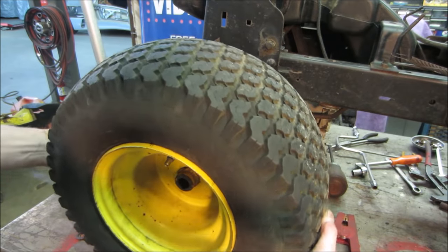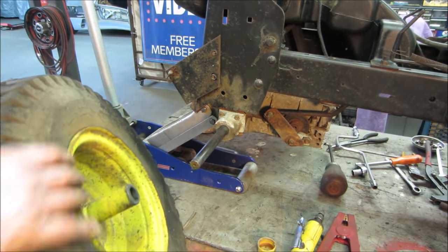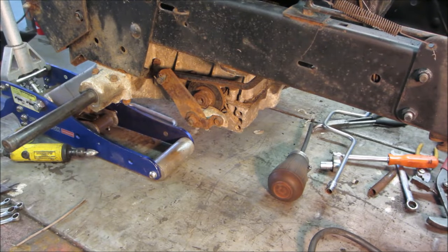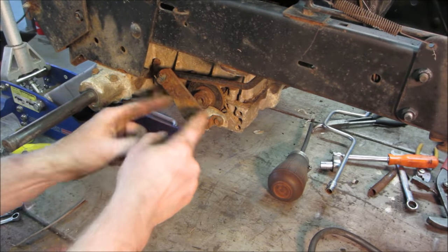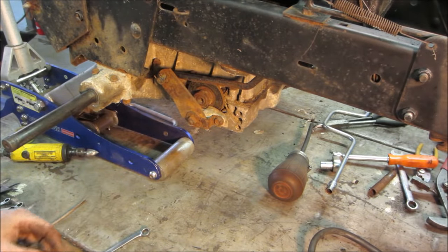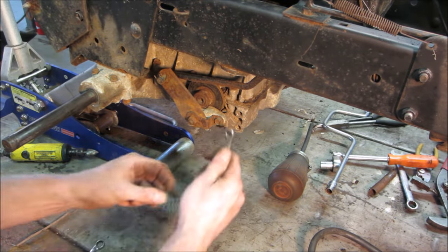You gonna come off? Oh, look at that. It's even gooey on the backside. Not all rust. All right, so now we can see the setup. Let me get set up to work on the setup. Right, so it's got a lever that's a cam. This is the lever. Got a cam on the end of it, and there's two pins that push in, and then there's a floating brake pad on the other side, and then the rotor is supposed to float to catch the pad that's fixed on the inside. Hopefully it'll come apart and it'll make more sense. Not sure what that ratchet is.